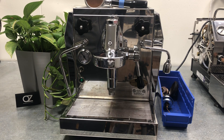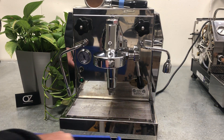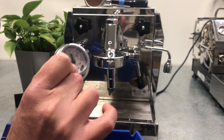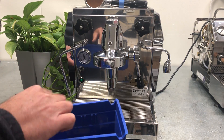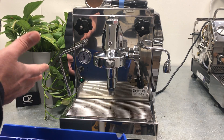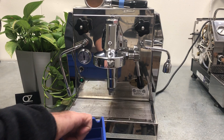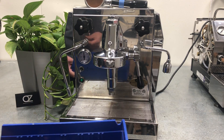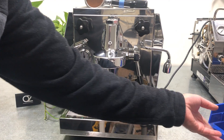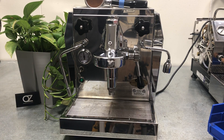Today we finished the repair on this ECM Giotto and we replaced the pressure gauge to show you some of the parts. The old gauge was just clogged and not reading, and then it was overheating, so we never knew what was going on. Now that we have feedback from the machine we know it's working well. We also replaced the pressurestat, screen gasket, safety and vacuum valve, and a few burned wires — and the machine is working well.